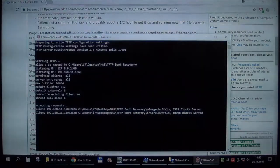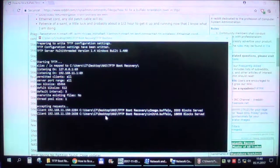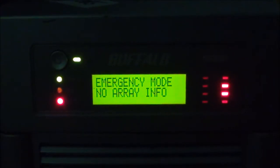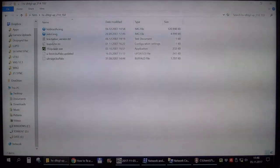The TeraStation isn't beeping anymore and I think this is about it for the boot recovery program. Let me take you to the TeraStation now. As you can see, we are powered on — we have some errors saying it doesn't find drives 2, 3, and 4, but we only have one, so that is absolutely normal. We are powered on, so let's get back to writing the software onto this thing. The NAS is powered on; we go back to the folder with the firmware and launch ts-updater.